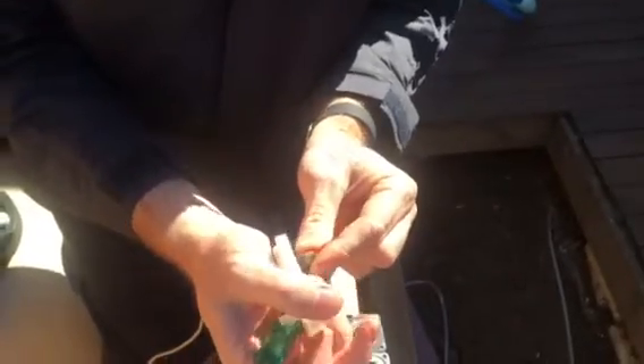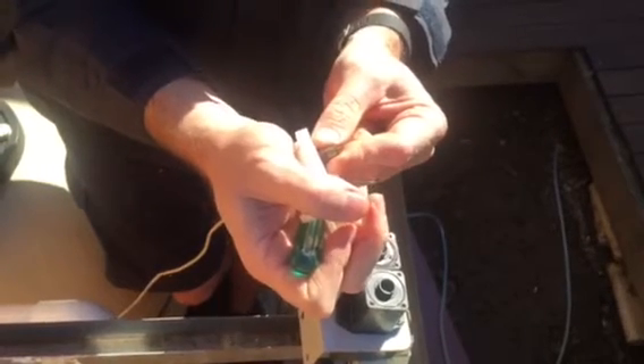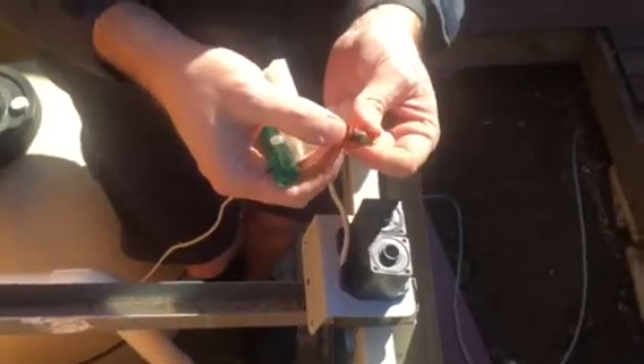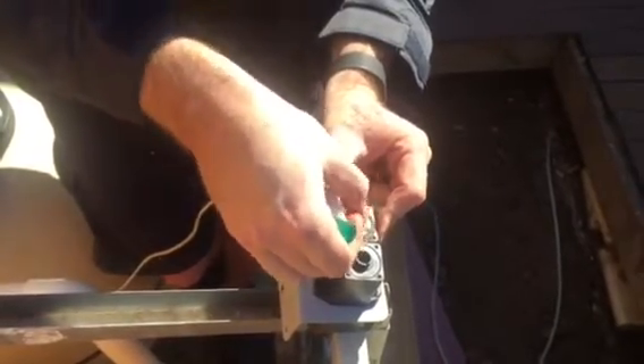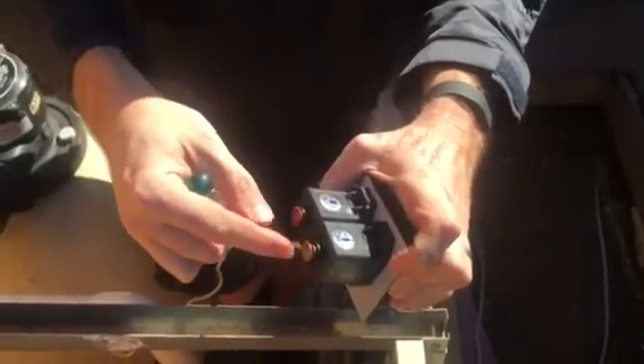There's a little spring inside there as well — that spring's all rusty too. Basically the way it works: the spring pushes it out into the closed position all the time. When the relay is energized, this big bit of metal pulls it open, and when it turns off the spring pushes it back in and closes off the gap again. If you do one you do both, so we'll have to come back and replace those. It should float freely back and forth — that one doesn't, but this one moves in and out quite nicely.